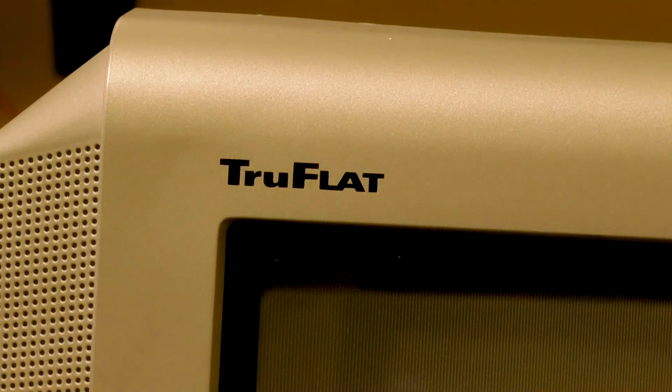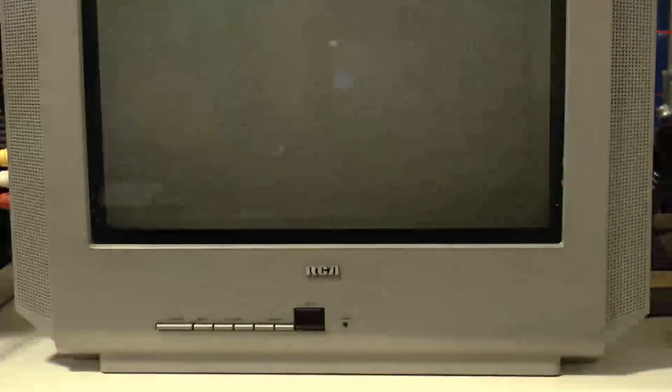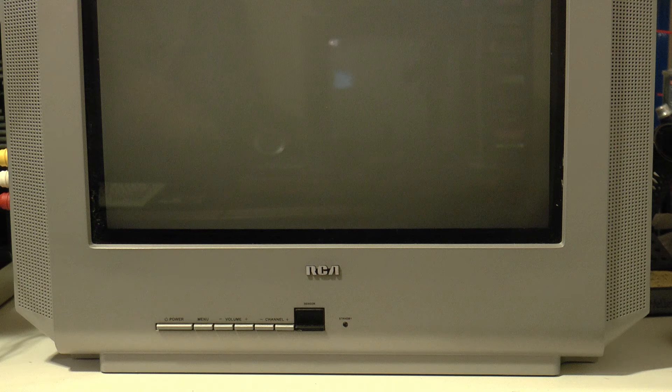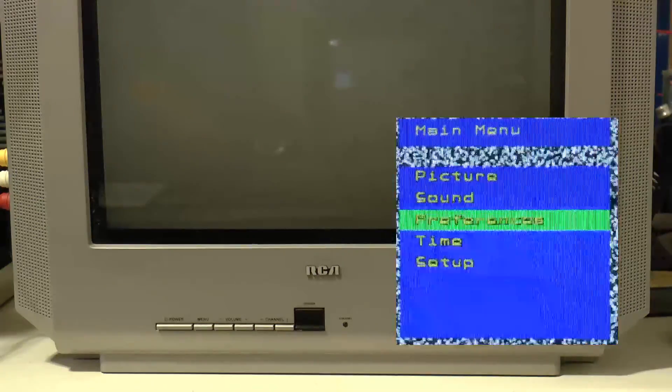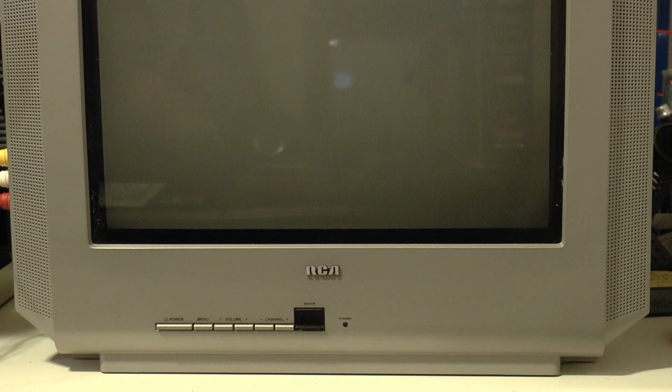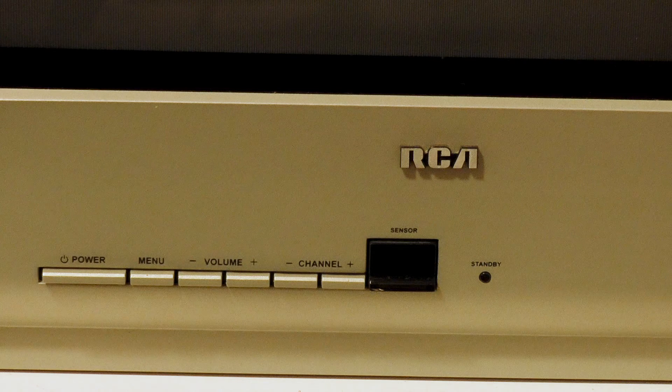This set, like many others like it, had an interesting problem. It turned on and off on its own. I pressed the power button and nothing happened. I pressed the menu button and the TV shut off. As a matter of fact, pressing any button other than the power button turned off the TV. I set it aside for a while. The next time I tested it, plugging in the TV turned it on. Pressing menu called up the menu and the selection box would just keep going down. After being turned on for a few seconds like this, the TV would shut off. After this point, it would not respond to the power button on the front panel or to a remote control. The only way to get it to turn on again was to unplug it and then plug it back in. These sets tend to have problems with their front buttons due to faulty tactile switches, and many experience the ghost in the room turning on and off the TV set because of that.